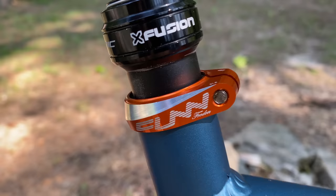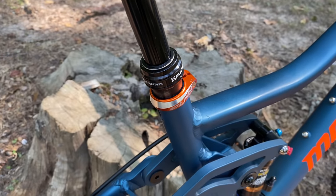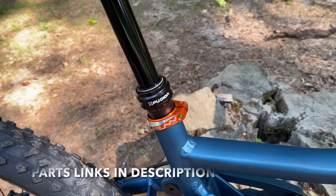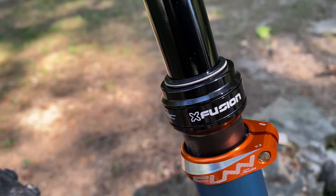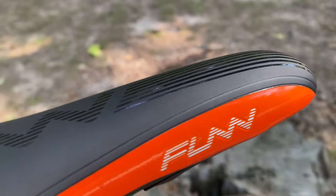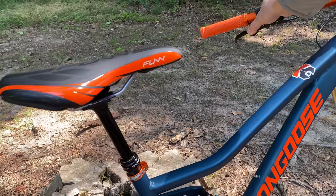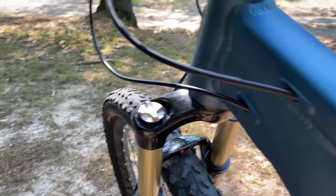More orange components — like this Fun seat post clamp. I read online that mounting the clamp backwards is better for droppers, something about equal pressure distribution, and I'm starting to see this done more often, so I gave it a go. Comment below what you think. If you're shopping for a clamp for the Ledge, look for 31.8mm diameter. For the dropper, 27.2mm. This is an X Fusion dropper — hence the X on the remote — capped with a Fun saddle, an ad-lib HD mountain bike saddle, color matching with quality looks. If you're confused about the dropper, it does this — that never gets old.